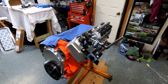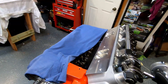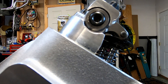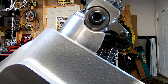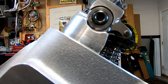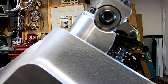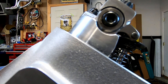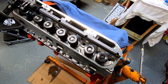I've talked to Mike at B3 Racing — their contact number — he is a wealth of knowledge. He's got some good tech articles at their website; I'll put a link in the description. Basically, they're able to use a little longer push rod. Using the longer push rod, the push rod doesn't sweep as much in the motion of the rocker working. Reducing that gives it more accuracy at the valve and also a tighter sweep pattern at the valve, which all increases longevity and efficiency. He said he goes to Carlisle and always has a booth set up, so if you're there, tell him hello, and if you have any questions, give him a call.